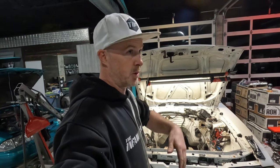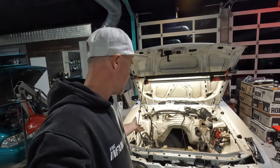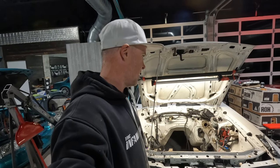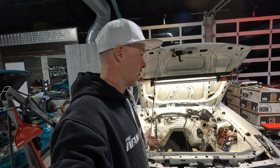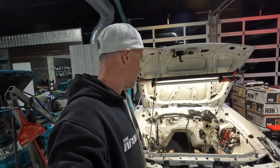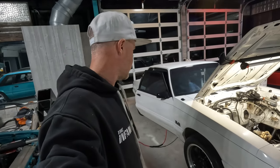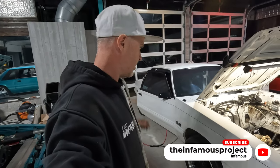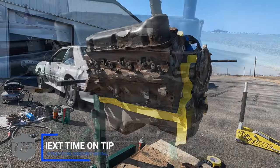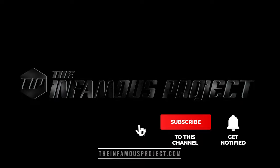If I actually had the motor sorted — it's on a stand but needs to get cleaned — I'll be doing my touch to the motor, getting that all shiny and prepped up. Honestly, the hardest part of the five-speed swap are the pedals. Once you get the pedals out of the way, the rest is easy. This thing should come together pretty quick and it'll be interesting to see how it drives. I know the motor runs good because it came out of that other car — we just need to do some magic, clean it up. I'm probably going to take this pinstripe off; it's hand-painted on there, so I'll probably get some thinner and get that off. The ugliest things now are the valve covers, the oil pan, and the timing cover.